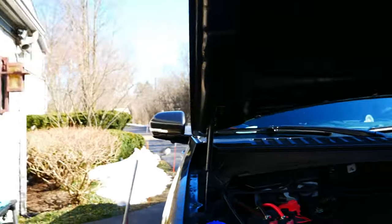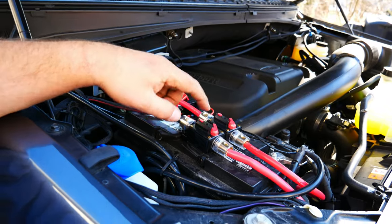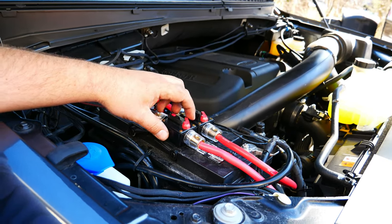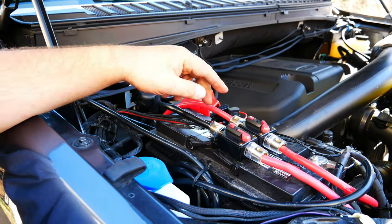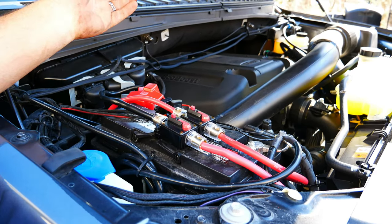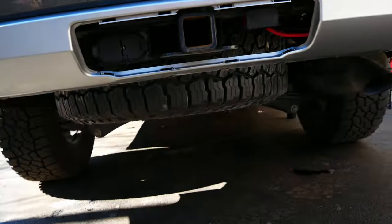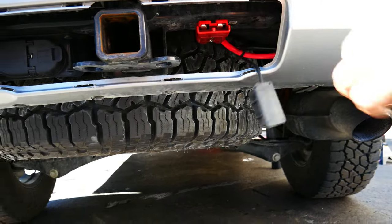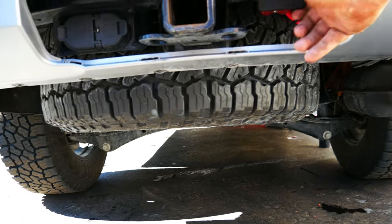That took a hot minute. Let me show you what I've done with the power cable in the back. Here is the wiring — this is my winch setup. I had the battery terminal first, now I've got these 500 amp breakers — very hard to find, I'll put a link down below. This is when it's tripped. That's the winch. I kept this cable black so I can visually remember the winch is going to do the positive. And then this is the power to the back — you can leave them on all the time. It is a breaker, so it's all secured down there. Most SUVs now have this cover that goes in here, so I just mounted it right here. I can be plugged into the trailer brakes here and then the power here. That should be set to go.